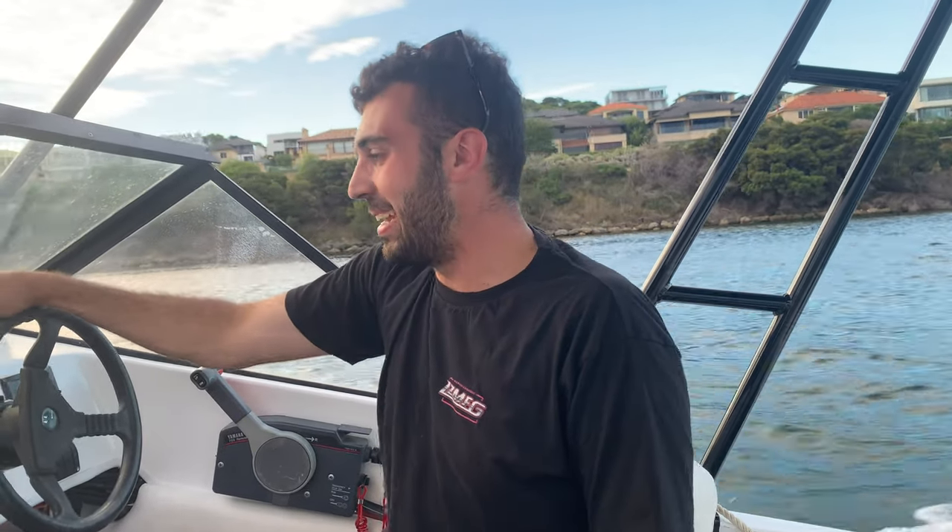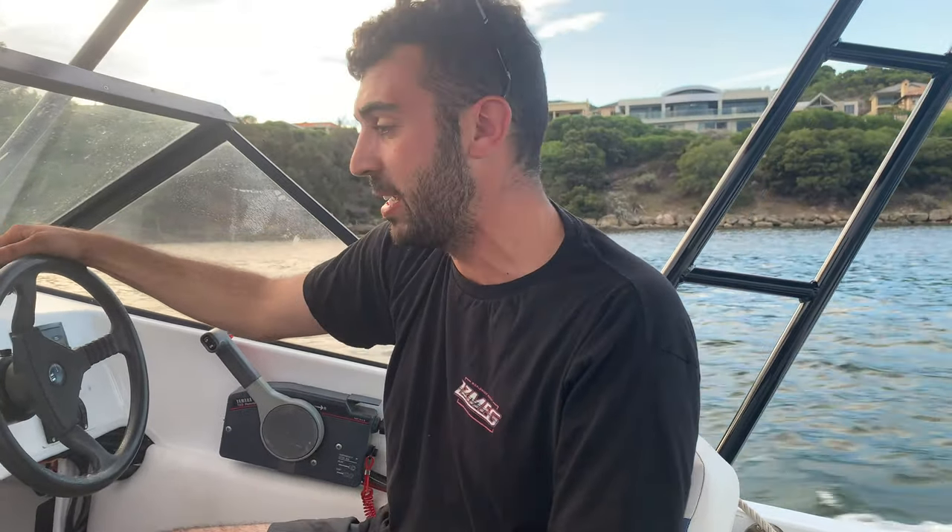I wasn't actually going to add this to this week's video, but I got too excited — I had to come out to the Swan River and test out the new outboard. I'm pretty impressed. It runs really well, it's so smooth, it's quiet, and it gets into gear really nicely. We're hitting about 5,700 RPM at WOT, which is perfect — you want it upwards of that 5,500 to 6,000 RPM range to know you're getting the max out of your engine. We're hitting about 34 knots, which is roughly similar to what we were getting out of the Evinrude with the canopy on. More than happy — engine's running good, let's go catch some fish.